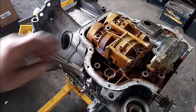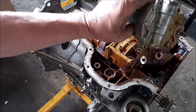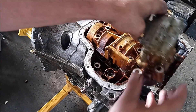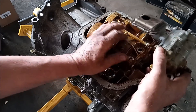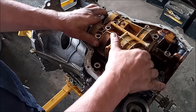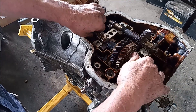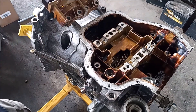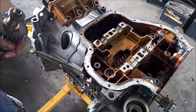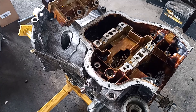This is the oil pump. It has a secondary chain that goes to the crankshaft; it's attached by some bolts and comes right off. This is unlike other Toyota motors where the oil pump is driven in the timing cover. This is the cover for the counterweights — just remove the bolts of the cover. These are the counterweights; take them off, and they're driven by the crankshaft through these gears. I don't know if anybody bothers to remove the counterweights on this motor — it would certainly increase noise and vibration.